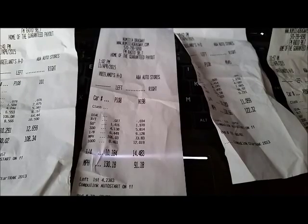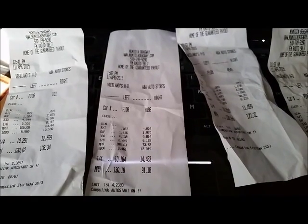But I did look around on YouTube, and everybody that's claiming to hit 9s on a stock motor, all of them have a cam. I didn't find any that didn't. You might, but I didn't. I looked around and saw a couple of them, and they all had something done to them. This one is bone stock, never done anything to it. Just the 80-pound injectors that come with my kit, valve springs that come with my kit, and a turbo kit, and then some tuning. That's it. Borderline 9-second car, which will be a 9-second car.